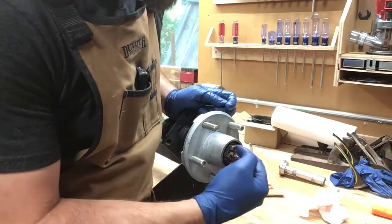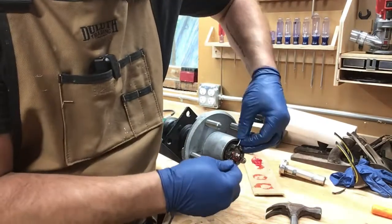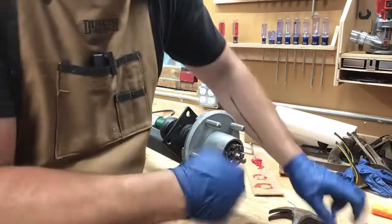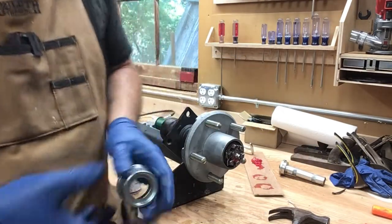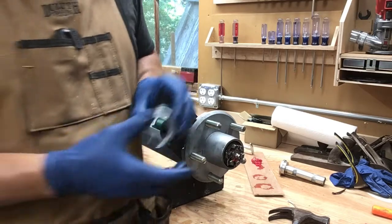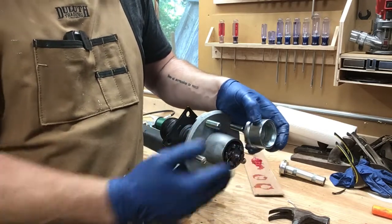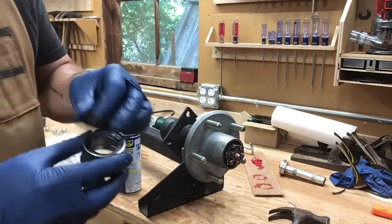If this was not an easy lube axle, there would be a hole straight through. Because it's easy lube, the hole is kind of at an angle here. This cotter pin doesn't really take any load — it just keeps that castle nut from spinning off with road vibration. Now, if we were using a regular axle that wasn't easy lube, we might put just a regular metal cover on it, or we might put a bearing buddy on it — which is a metal tube with a floating plate and a spring. You grease it up, hit the zerk in there, pump it up, and that spring pressure will force grease in. But because it's easy lube, we have this cover — a metal cover with a rubber cap that goes in the center.